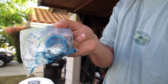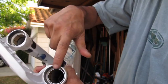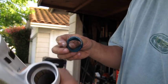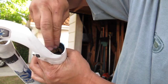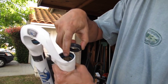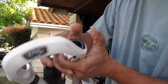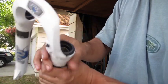The replacement foam ring has been soaking in float fluid. It sits just inside here on both sides. Just take the foam seal and place it right in there. Then install the dust wiper seal — make sure you don't pinch or crease the foam ring. Place it on by hand and push it down. Double-check that it's seated all the way around.